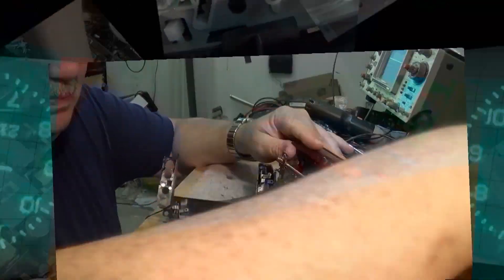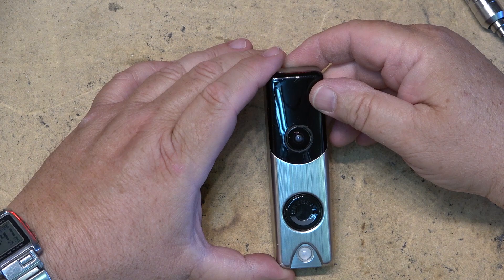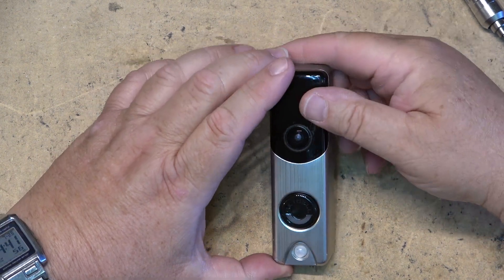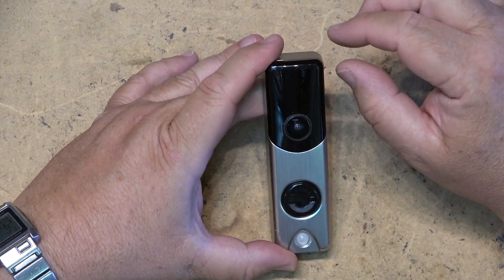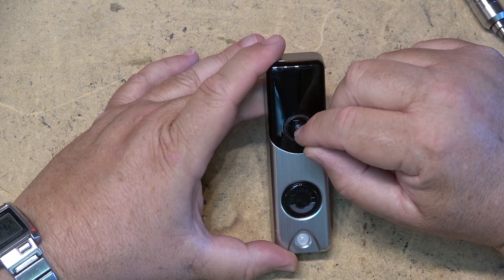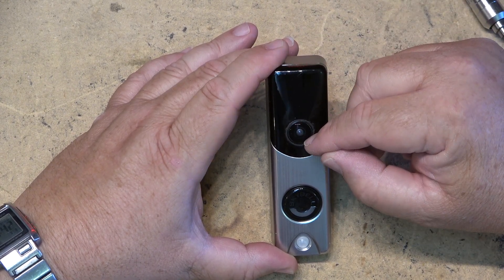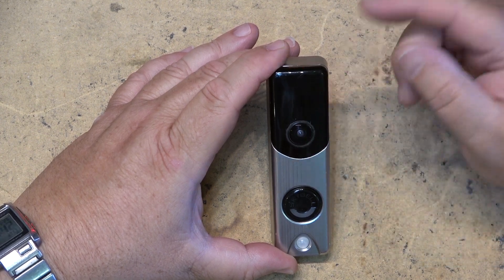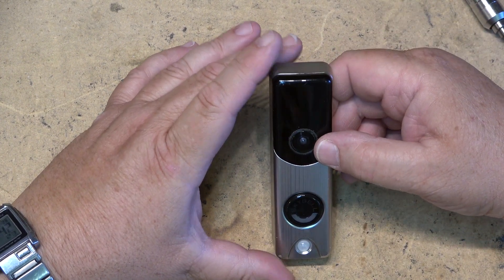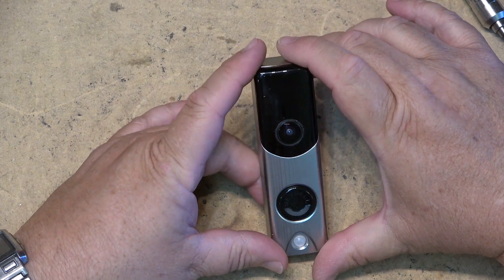This one here had the picture go all pink, so I had to go replace it. This SkyBell Slimline doorbell was replaced because the picture on it has gone pink — it's like it doesn't have an infrared cut filter. Most color cameras have a mechanical filter that moves out of the way so the camera can operate in infrared mode at night, and during the day the infrared filter goes back in front of the pickup. The symptom looks just like one where the infrared cut filter is either stuck or missing. This one was swapped out; I have no way to test this unit because it requires an account with alarm.com.